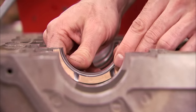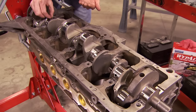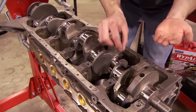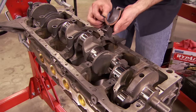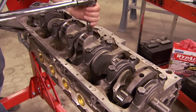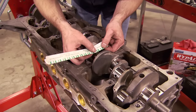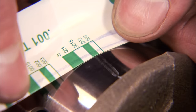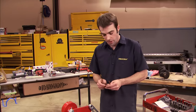We'll start our reassembly by laying all of our crankshaft bearings, including the thrust bearing, into the block dry. Now you only want to reassemble the bottom end one time. Measuring for bearing tolerances is kind of Mechanics 101, and it's a necessary step with any build, especially a mild high-performance build like this stroker. Ryan's laying a piece of PlastiGage on the top of each bearing journal. PlastiGage is a way of measuring the space between the journal and the bearing surface itself, and that's accomplished by installing the main caps and torquing them to spec. With your caps removed, you can use the guide provided by PlastiGage to measure your tolerances. At 2 thousandths — that's perfect. With our crankshaft main bearing journal clearance within spec, we can install the crankshaft for the final time.